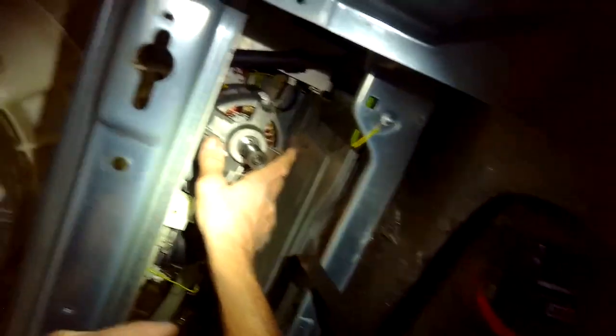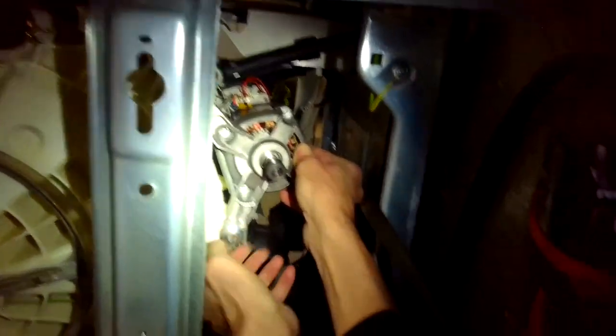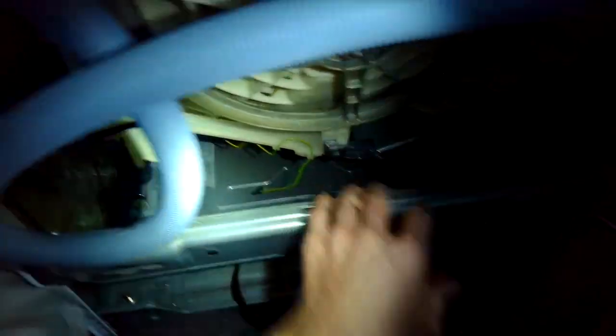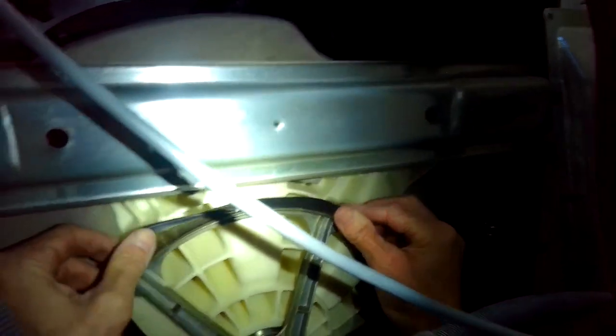We get the motor ready — we've already got it plugged in, the front panel is back on. We just need to tighten up the screw and then add the belt back on. To get the belt on, put it on the little motor pulley first, then bring it up over the big pulley. Make sure to put that green ground wire back on too.